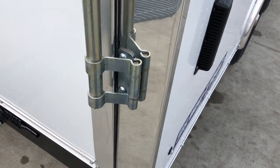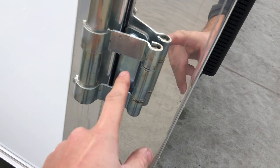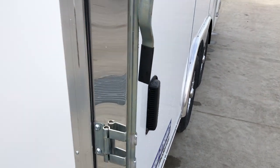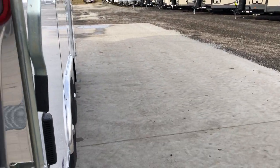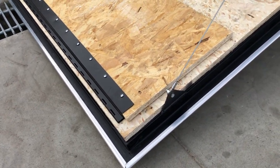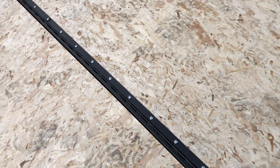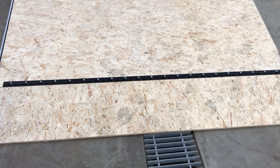The door hardware is quiet — notice it didn't squeak when opened. This is security hardware: rather than going across the center where a thief could fairly easily come by with an impact driver, this setup keeps honest people honest. The ramp flap extension uses a Z-hinge so the hinge doesn't have to worry about getting ripped up. There are also two to three times more lags on this ramp flap extension — a small detail, but if you're a contractor using it for a year or two you'll appreciate it. Some manufacturers only put a lag every 8 to 10 inches and it generally comes off over time.